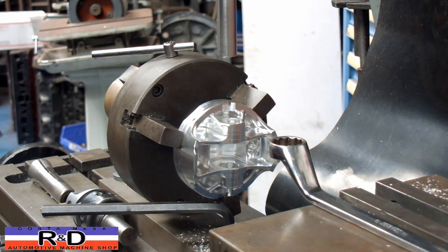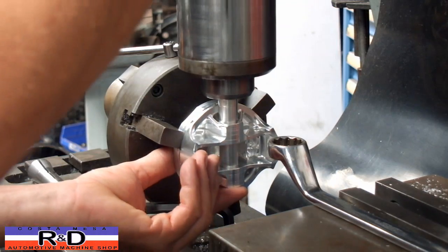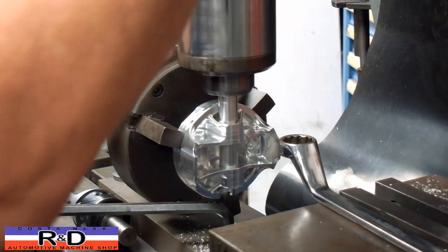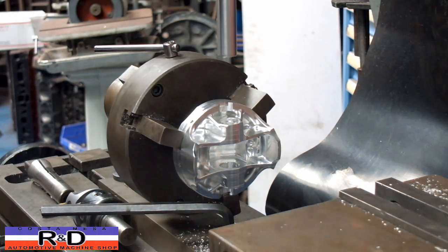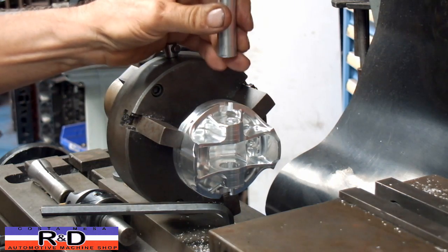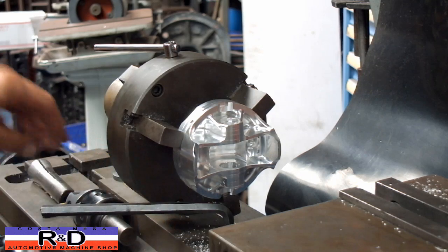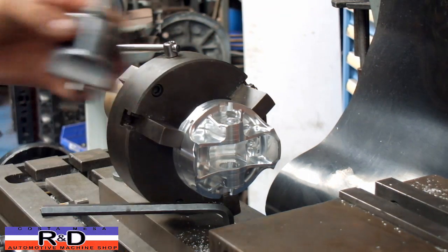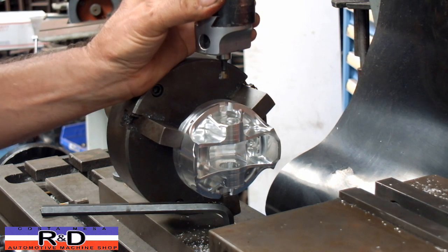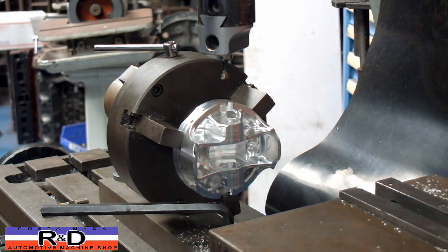The fifty-thousandths offset is to make the piston a little bit quieter. As most of you probably know, forged pistons are a little noisy because of the extra clearance we have to give them. If you don't give this some clearance you're going to wind up moving the center line of the pin, which wouldn't be good. Any time you're honing something, you have to have clearance around it — having this little chunk sticking in the way is going to force the hone off to one side.